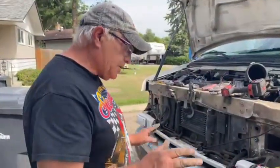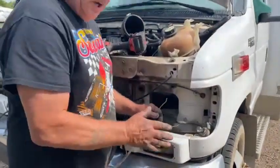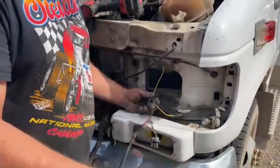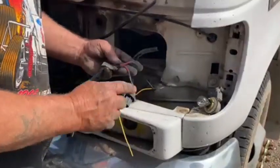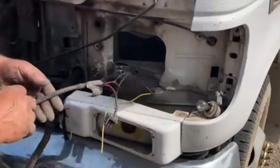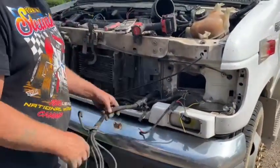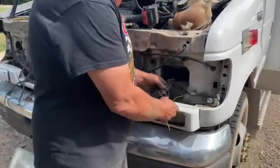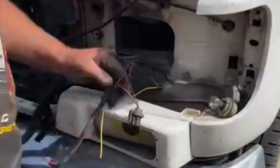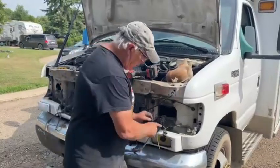We're still working on the harness. Now you see the front of the truck's apart. The reason for that is you don't want every light flashing on. I'm going to show you why - this is hooked to the right turn signal and this one here is your headlight. Now when I cut this wire from the main harness, the headlight quit. So I go back in and see, they put it in series. That's how come when they have their lights flashing, you can always see the headlight flash - because it's hooked on the high beam and it always flashes.